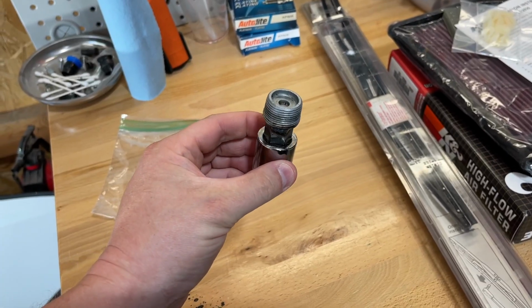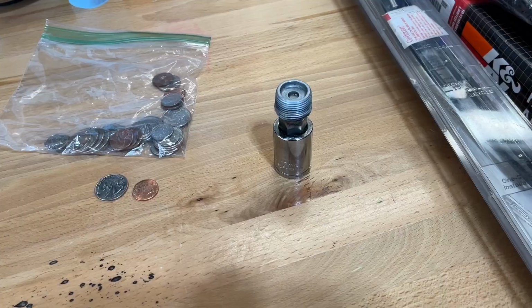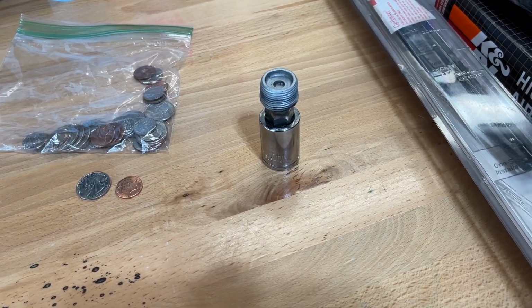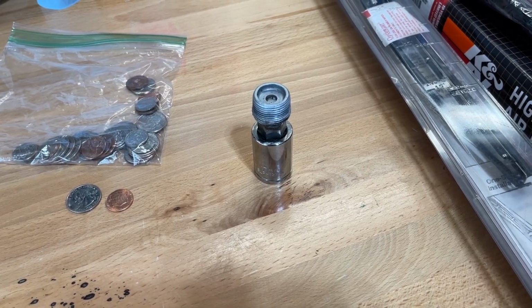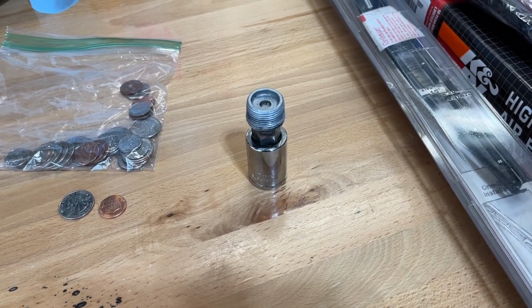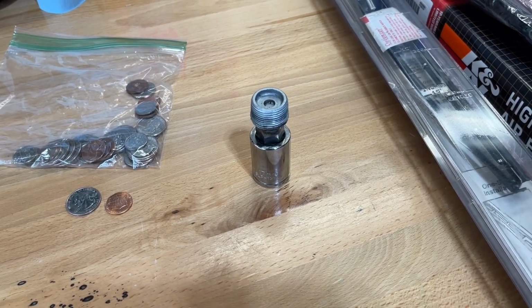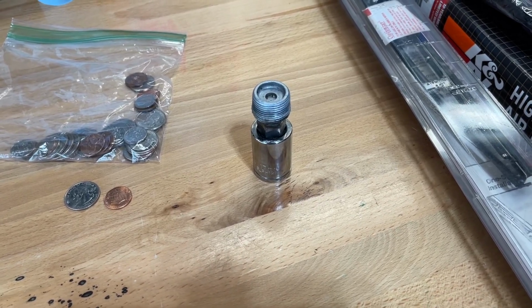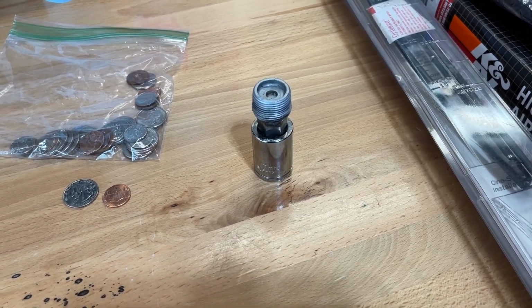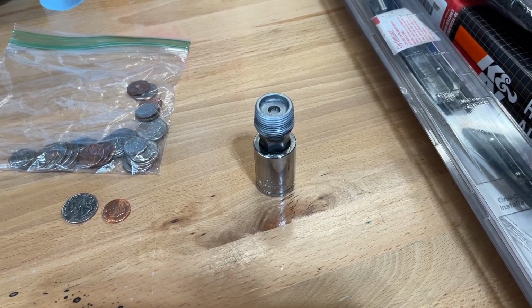I took the car to Premier Performance to get some help, and they weren't able to remove either of the plugs. They actually took me back into the shop and showed me what was going on, and the mechanic had a butane torch that he was using to heat up the plugs. He had breaker bars, he had a 1/2-inch drive impact gun, and nothing was working. So ultimately, they recommended that they weld the hex sockets to the plugs, and that should heat them up enough to get them to come out.